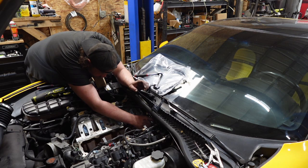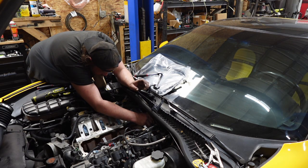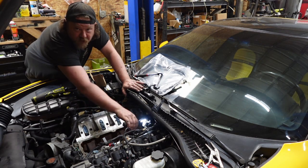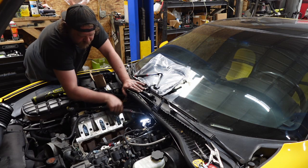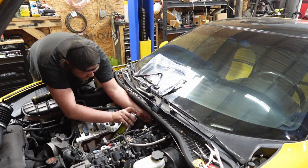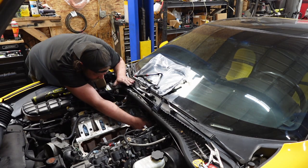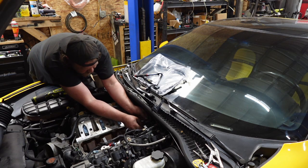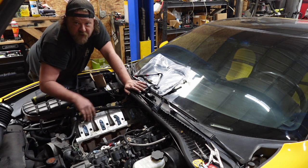All right, guys, cam sensor and oil pressure sensor cleaned up. Now let's install her. I feel better, obviously, that I saw a leak in there. I will clean the connector for obvious reasons. I'm not saying that this was my oil leak, but stuff is definitely leaking on this engine. Pull this and then connect it. It's pushing back, so I'm gonna push the pins back in at least. But there we go. All right, that's fixed.